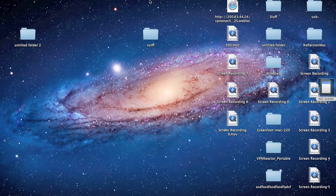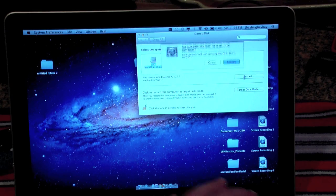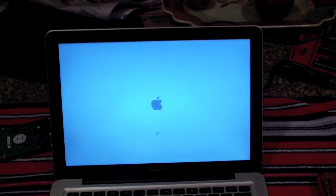For the third option — if you get a black screen that says 'no bootable disk' — hold down the Option key and click the power button. Hold Option and do not let go. In about ten seconds you should see a menu appear, then you can let go. Mine is called 'solid state drive' because that's what I named my disk when I formatted it and backed up my old hard drive. It is a solid state drive, so it should boot really quickly.